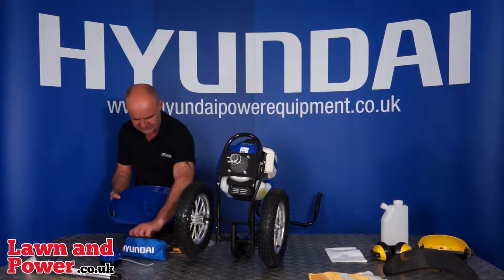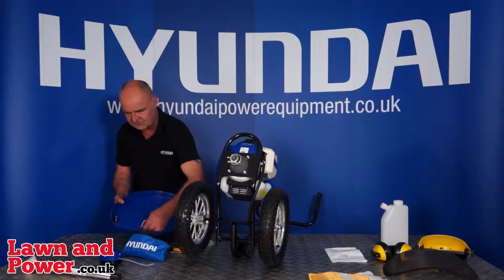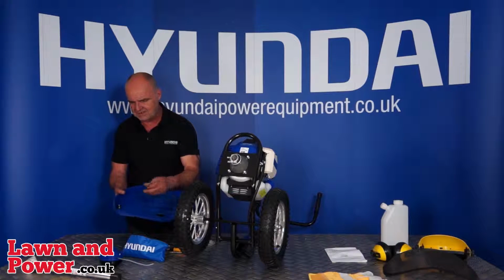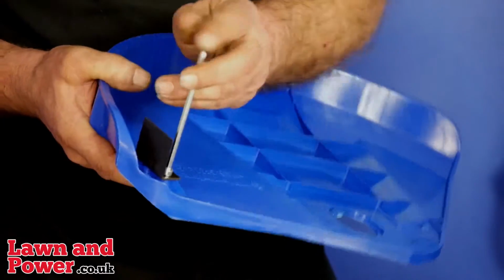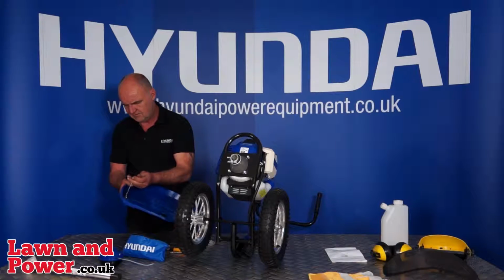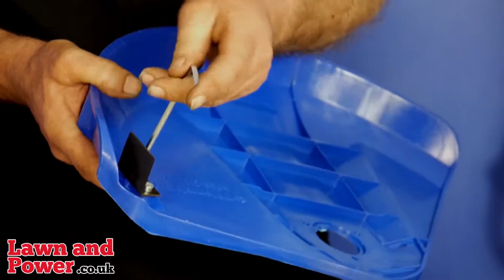Now we need to tighten the nuts. Again in the toolkit, you'll see there are 2 Allen keys. What you'll need is the thinner of the 2 Allen keys, which is 4mm. Being careful not to catch your fingers on the sharp edge of the blade. Tighten up the 2 bolts. Probably using the Allen key long ways, you can rotate it completely and you'll be away from the cutting edge of the blade.